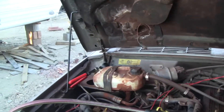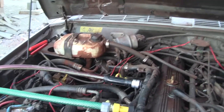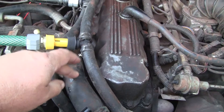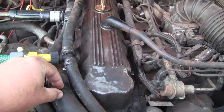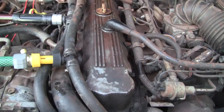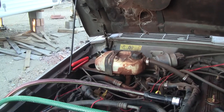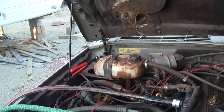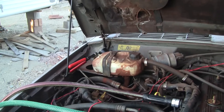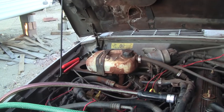My suspicion is that Renault had something to do with AMC back in the day, and on their Renault radiator hoses they had a bleed valve mounted on the highest hose in the car. So you'd fill the cooling system and crack this thing open to bleed all the air off. There's no screw in that thing, so I don't know — maybe you drill it out. I thought this overflow bottle was some jerry-rigged aftermarket thing, but it's all factory — that rubber strap with a slot in it is 100% factory.